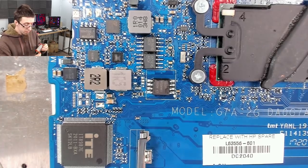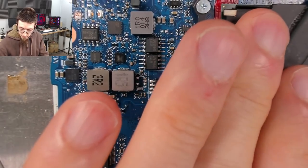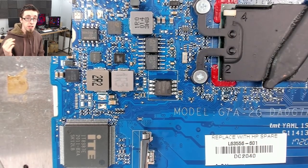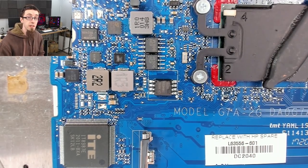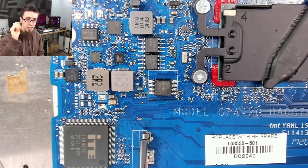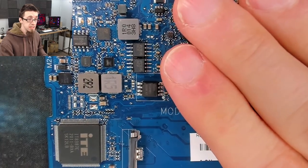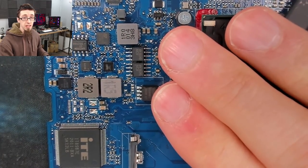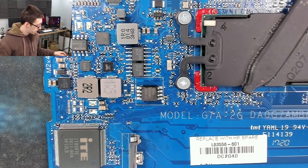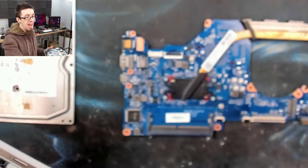I don't want to stay in there with the hot air for too long — the longer you're in there the more likely you are to break something. As things stand I can touch the CPU quite happily. Remember: if you can touch it with your bare fingers it's probably less than 50 degrees, because around the high 40s to 50°C is the point where it'll actually burn your finger. That's always a good indicator of how hot something is. Let's put this back in the case, wire it back in, and see if anything has changed.